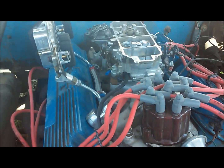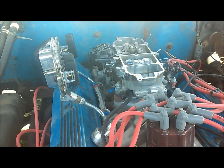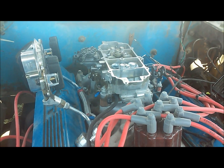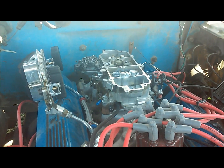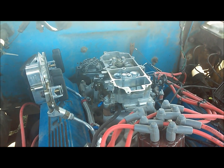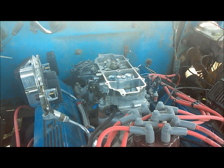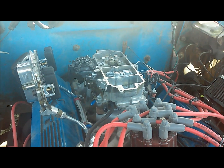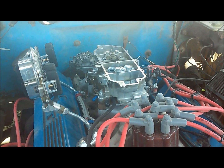I want to talk jetting quickly. Depending on your engine, what type of changes your jetting will require from your stock carburetor. We all know that temperature and altitude affect your jets. With altitude, every 800 to 1,000 feet higher you need to pull some jet because you have less oxygen. With temperature, for about every 20 degrees above 70 degrees you need to pull jet as well, because the air is getting less dense — and it's the opposite on the other end of the altitude and temperature spectrum.